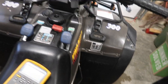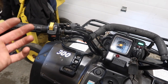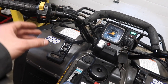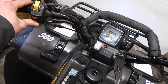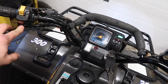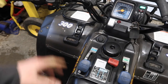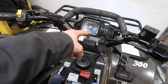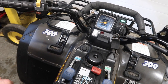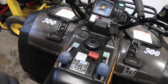That's why I wanted to put this in as a follow-up to my CDI video — it's one key feature. It's not like other ATVs where they ground out the kill switch, where you could crank it forever and it would never start. On this Suzuki, it does not even allow you to turn it over when the kill switch is off, because it opens up the circuit between the solenoid and also shuts off 12 volts to the CDI.